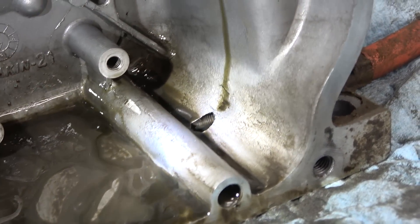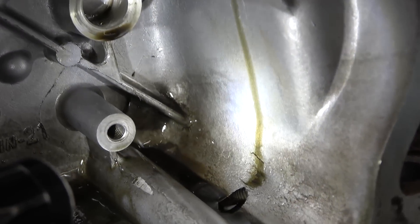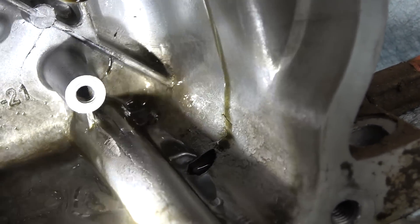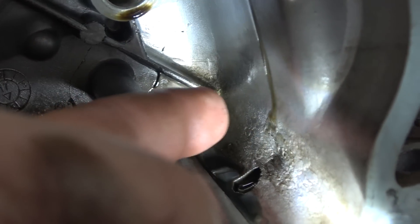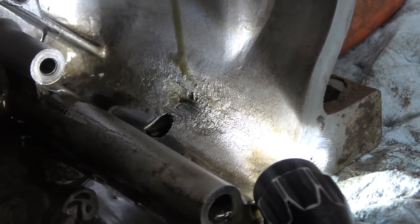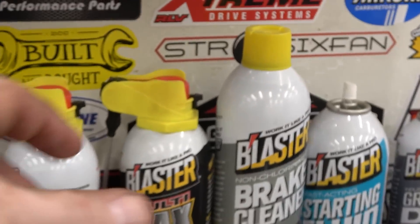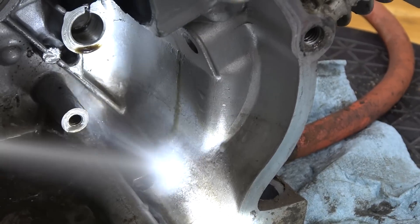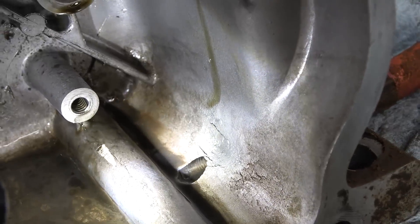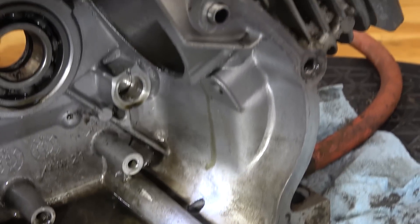I was about to make the outro for the video and noticed where that oil is leaking down — the oil is from the little weep hole between the lifters — but look how the block is crushed right there. I've never seen that before. It's like there's an indentation right here. Very poor casting on this engine. It looks rough. The block looks like it was breaking down to that oil drain. It was running fine and not leaking, so we'll keep on pushing her.